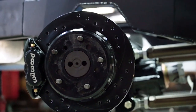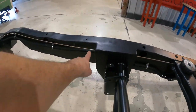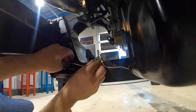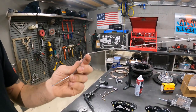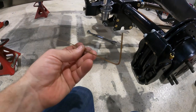We're getting everything ironed out as far as the hard lines go on the chassis. We're going to make one hard line going straight from the master cylinder in the engine bay all the way back to the rear axle, and two hard lines at the front under the engine on the cross member to power the two front brakes individually out of the Wilwood master. What I like to use is welding wire — instead of wasting your brake line trying to bend it in place, get yourself a pair of side cutters, cut the welding wire to length, and fit it up in the truck. This welding wire is silicon bronze, so it's really easy and flexible.